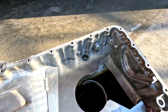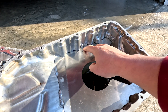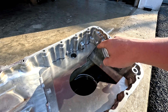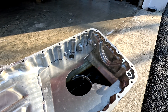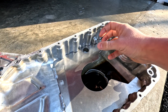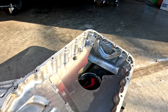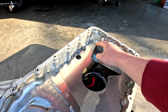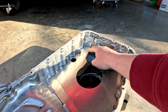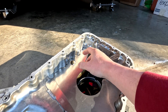The Alloy Craft design actually has these bent tabs with the intention that you just weld the bent tabs to the pan so that with thermal expansion over time, the baffle welds do not get pulled on and pushed on and causing them to crack. That design is good on paper, but in reality it looks like the bends failed from either vibrations over all these miles and track miles or just from heat expansion and flexing that bend over and over again.